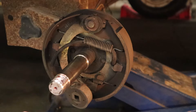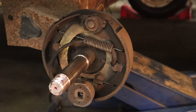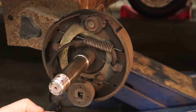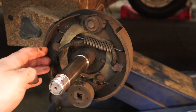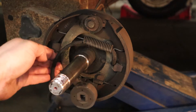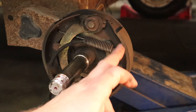The cool thing about electric brakes is there's a little electromagnet here. When you hit the brake pedal, the brake controller sends a certain voltage which makes the electromagnet a certain strength. This part sucks against the side of the brake drum, and depending on the direction of spin it starts to move the components and extend the shoes — kind of like an exaggerated emergency brake setup but using an electromagnet to control braking strength. For these magnets, there are four little dots — if you can't see the dots or they're very shallow, it's time for a change. I can see them and they're a couple millimeters deep, so this is good.